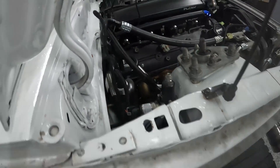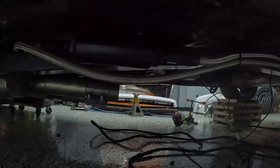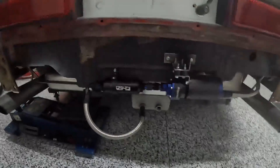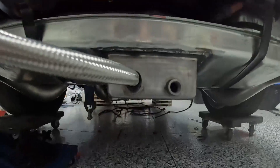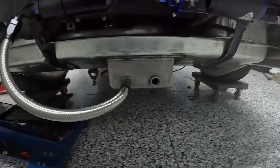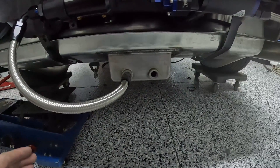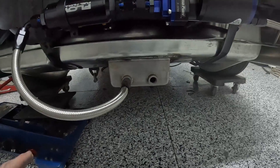The lines sneak under the car — there is one inline filter. Everything comes back to the back of the tank. Tank-wise, I purchased a new fuel tank and welded on one of these Summit sumps. I pressure tested it. You don't want to weld a sump onto a used tank — there are people who say they do it, but for the $150 Canadian a new tank costs, it's really not worth setting yourself or your shop on fire. I'd recommend just buying a new stock tank.